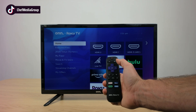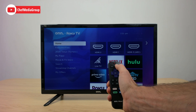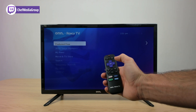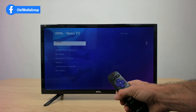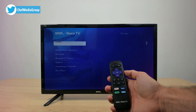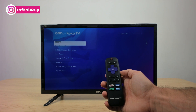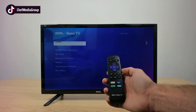So let's do it together: home screen five times — one, two, three, four, five — up screen once, rewind twice, fast forward twice. As you can see, all of my channels were kind of going haywire, and then it's going to stop and it's going to freeze. This means that your Roku TV is resetting. You have to give it about a minute and wait for it, and it will reset and turn off your TV, and you can see what that does to your Wi-Fi afterwards.